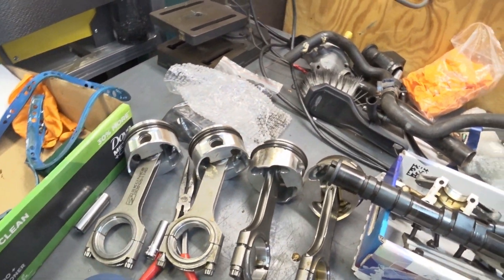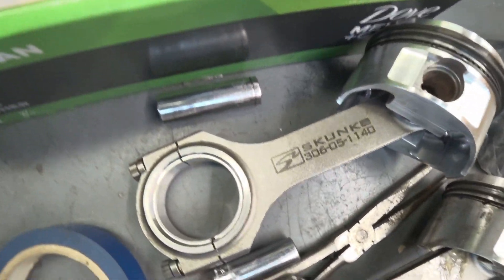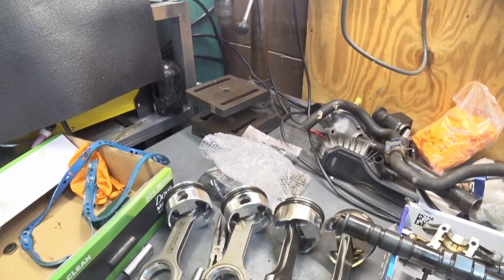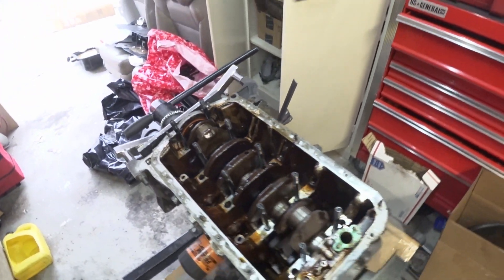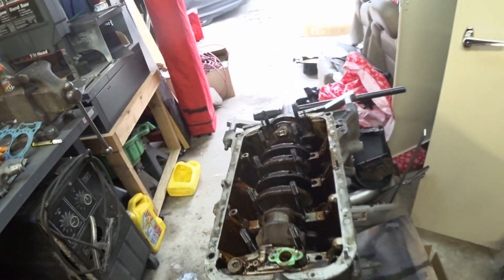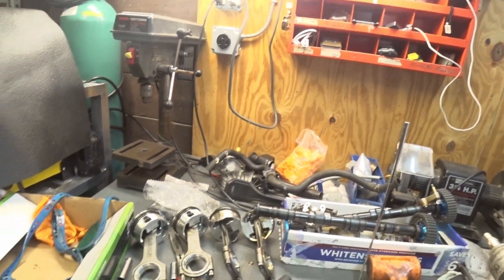I'm gonna do a little more measurement. I have the spec sheet for the pistons — these are the right numbers — but now I have to do measurements because I believe these are the wrong rods. The motor was never ran; there's no way it could have run. They just assembled it, put it together, everything seemed brand new except for a little scuff mark. I'm checking which piston that is and inspecting the crank. It seems the issue is the wrong rod — either too long, too short, or just too tight — it did not spin freely.